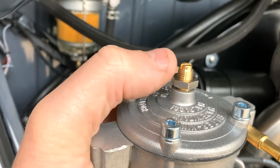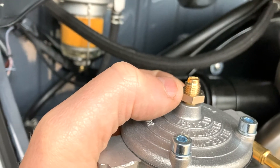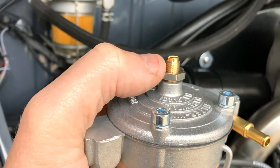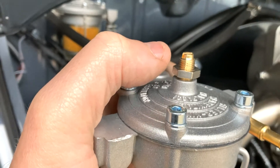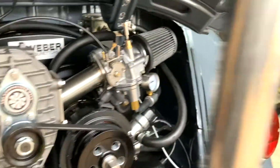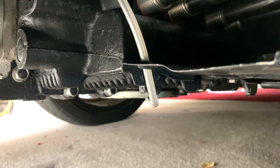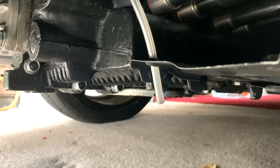If you're running at the preset method we've set it to on our rig, take it down to 2 psi, take the car back out for another drive - you don't need to go far. Come back and look for any signs of fuel from the overflow pipe. If you still see it, keep repeating that until you get down to around 1 psi. Just keep adjusting this outwards and locking it off until all you see from your fuel drain pipe are simply fuel vapors. When you get to that point of only seeing fuel vapors and no physical fuel, you're good to lock the fuel pressure regulator up.